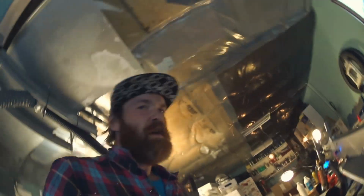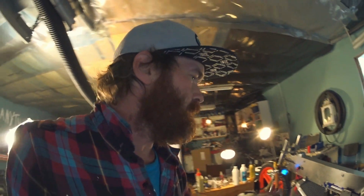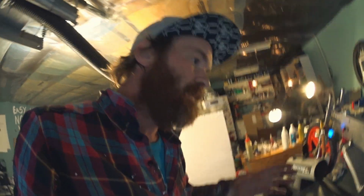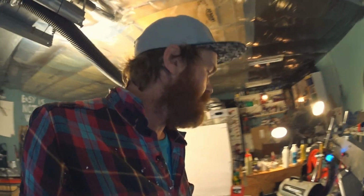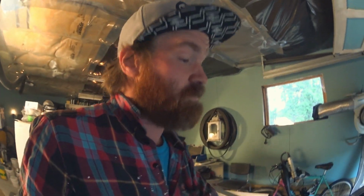It's running again, and the crank hasn't bent yet. I'm hoping it won't either. The variator is tuned too low still, and I can't get it up to high enough RPM because it's continuously variating. What I think I'll do is pull out the weights and see if the belt won't slip with the weights out. And then it will stay in first gear forever. So let's try that and see how long we can do this before my girlfriend comes home and starts complaining about the noise, because it is extremely noisy.